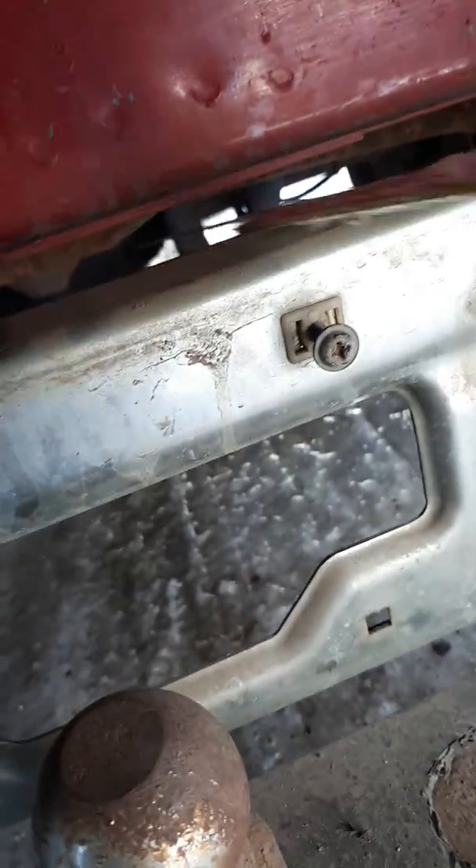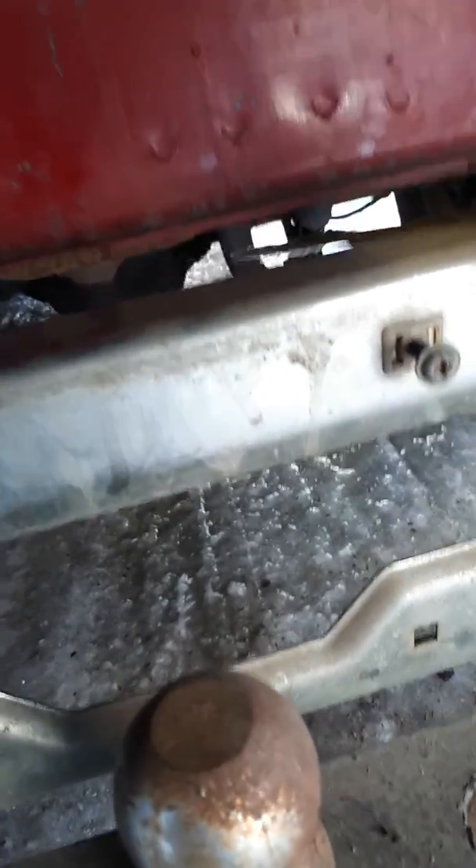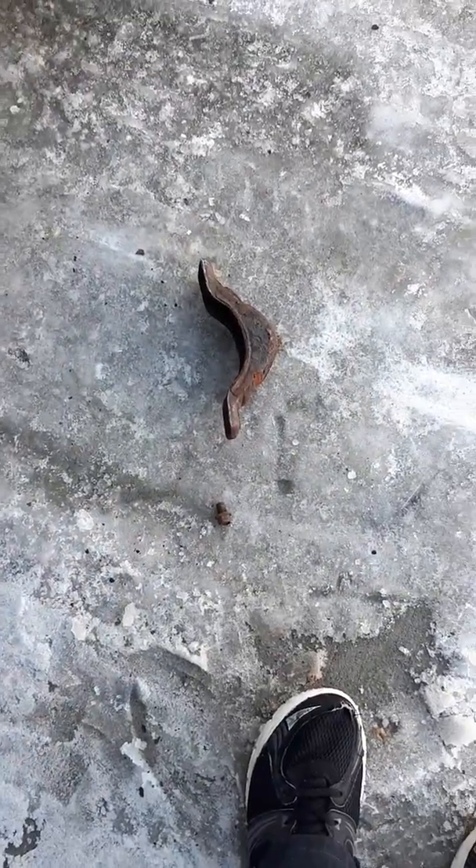Basically, you've got to make one of these — all you do is tape a hacksaw to this here aluminum meter stick, but you could probably also use a T-square or something like that. All you've got to do is slip it in through here, and you should be able to see the cable, and you just cut it off. I thought it would be hard but really it wasn't — it only took me a minute. There's the thing there. I put the tire in storage, but that's all you need to do in order to remove the spare tire.